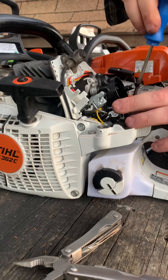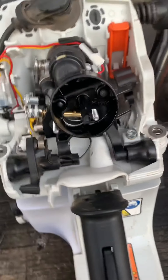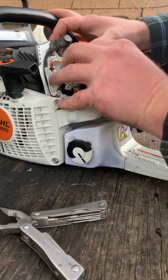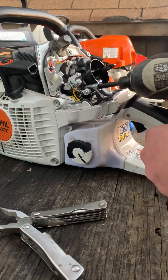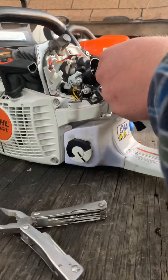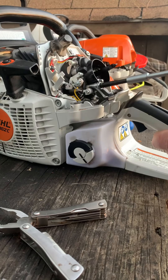Secure it in place and put that right-side rubber mount back in. I use a flathead screwdriver and press it until it's home — you want everything looking just like it was when you opened it up. Reinstall those two nuts using your 5/16 or 8 millimeter socket. Snug them up with an impact, then switch to a hand tool and finish by hand. Don't over-tighten these and break anything.